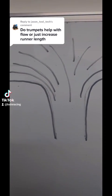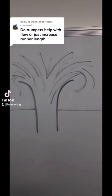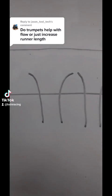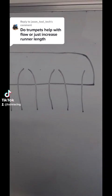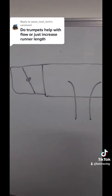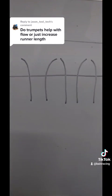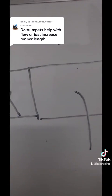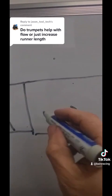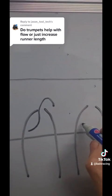We see this in a lot of OEM stuff with really close throttle body positions, as they lack that expansion or slow-down zone from the throttle body. So with a very perpendicular throttle body and very parallel roof, this would be optimized to have trumpets, mainly because we can utilize that dead area to flow underneath and around the trumpets. This is where a lot of OEM manufacturers do this — the small plenum makes them very reactive, and the trumpet tends to allow better spread front to back as the air can flow down, under, and around the trumpets and enter the cylinders needed.